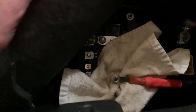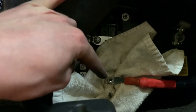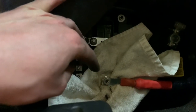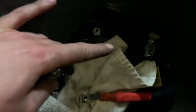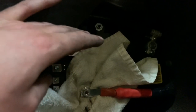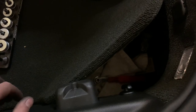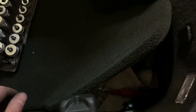Also, I forgot to mention to disconnect the battery — it says so in the little covers and stuff. To do that, you just remove this piece of carpet right here, flap that up, and then kind of lift this off or pull the whole thing off. Then disconnect — I just went with this screw right here. I started to take one off and then put this one off and set it on a rag so it's not touching anything. The black one is still connected and it was sparking a little bit when I was pulling it off, so don't be alarmed. Everything was off — you'll tell when the lights turn off. Just reverse the order to put it back together and all that with the computer and stuff. Take pictures so you don't forget how it was.